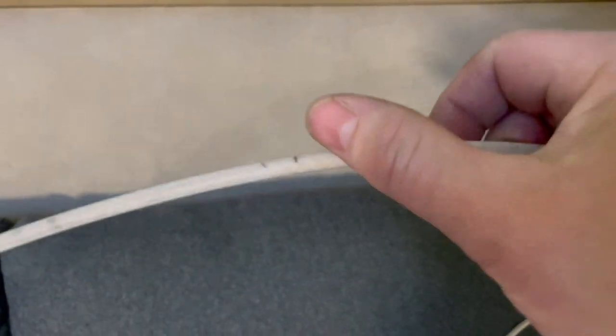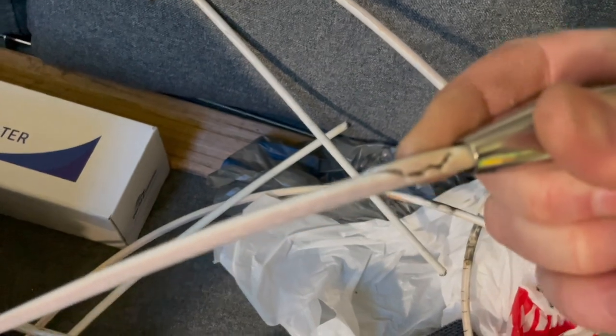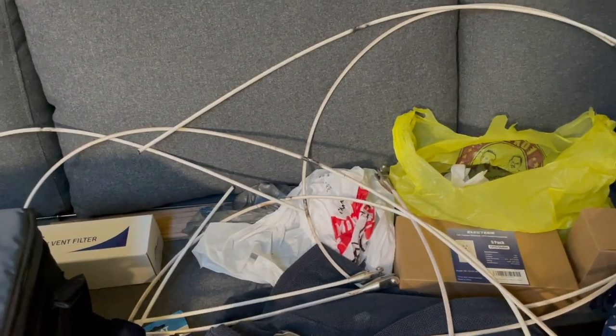You can hear this stuff crack — it's so brittle. There are some areas — yeah, here we go — that's a really nasty split that could easily cut someone's leg. I'm happy that I'm doing this. The new stainless steel non-coated lines are going to look awesome. The cutoff wheel worked great. I'll admit to a silly try with the cable cutters — that's the result of trying to cut stranded stainless steel wire with cable cutters — it just doesn't do anything.